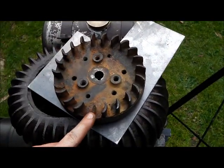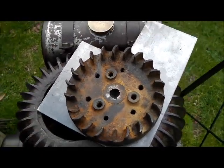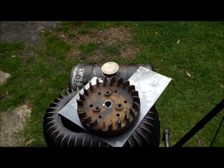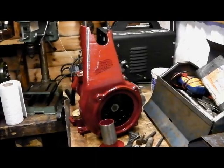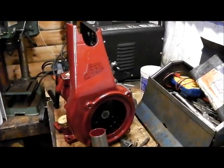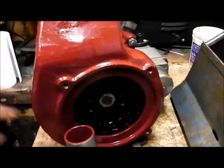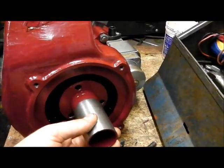A couple of missing fins but I'm not going to worry about those - not a lot I can do about that. So I'm just going to clean it up and hopefully get it primed today. Right, so that's where we've got to today. The cowling's fitted and I've put the flywheel on. So tomorrow I'll try and make up some spacers to fit the pulley.